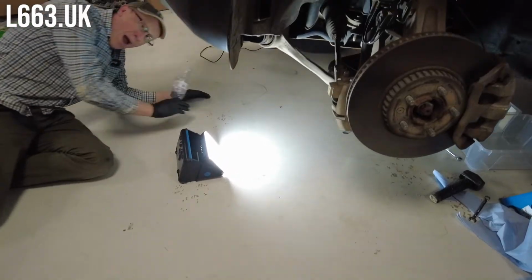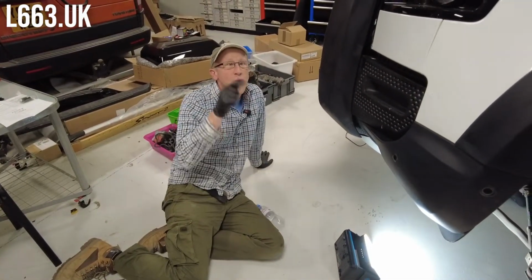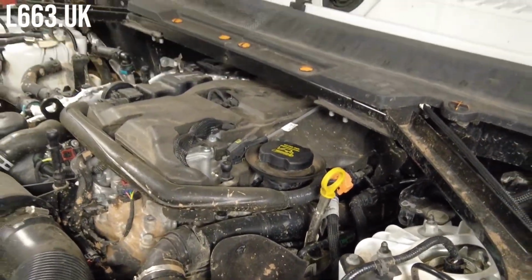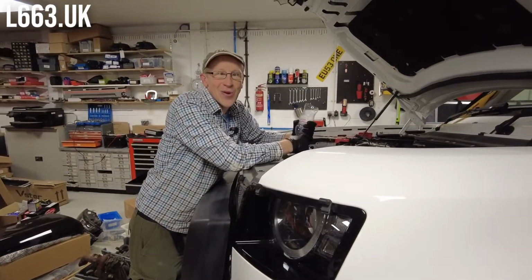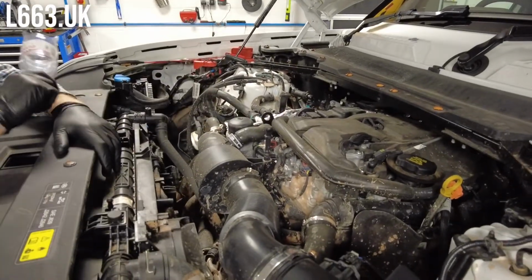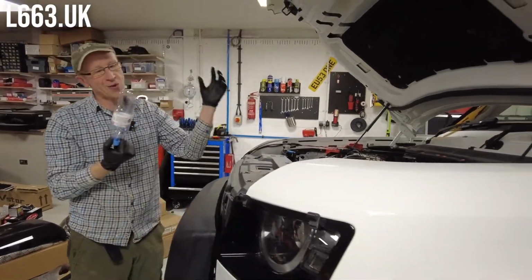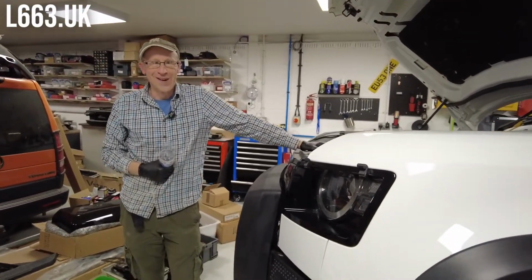So, right, a couple of things. I did read a couple of people who've done this on the forum. They said don't take off your oil filler cap, because it allows the air in and it drains even quicker. So I can't remember who wrote that, but we're going to leave the filler in. Likewise, we're not going to take the oil filter out, so it's sort of pseudo sealed. I'm hoping it's going to slow down that initial purge. But 7 litres of oil on my workshop floor.